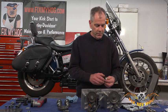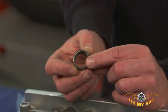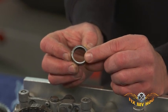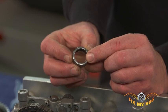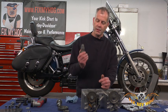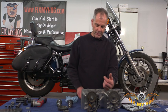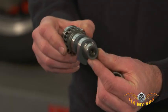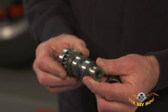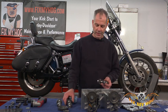If you're going to keep this motorcycle, pull the cams out, do a thorough inspection, replace the factory lifters, and replace the inner cam bearing. Here's the factory cam bearing — it's a cage bearing, and these can deteriorate around 50,000 miles. What S&S does is they use a Torrington bearing — there's no cage in it. We've been putting these gear drives in for the last 16-17 years; I've got customers with over 100,000 miles on their bike, never a problem with the inner cam bearing, never a problem with the hard face coming off. These factory cams are soft, the hard face wears out, and it's a very anemic EPA-compliant cam — we really just don't put a stock cam back in.